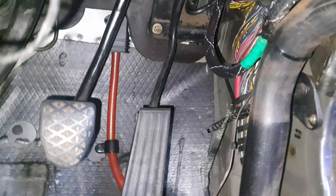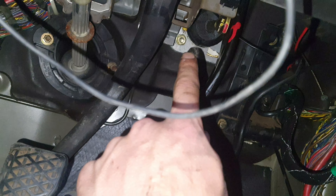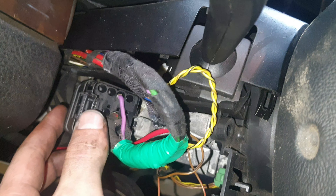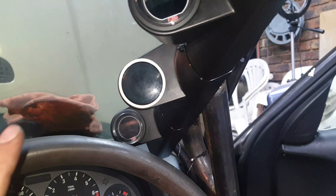Alright, we're all done in the front. The wiring runs to the front for the sensor, the black earth wire runs across and is grounded, and the positive is tapped in on the ignition side here. So now we have power, ground, and the sensors are all connected. Before I show you what it looks like, I want to head outside first and switch off the lights so we can see what it looks like at night.